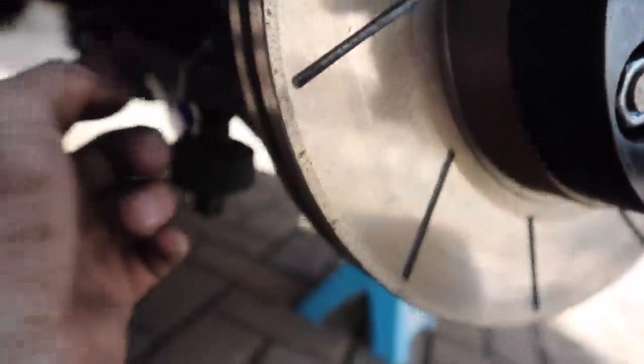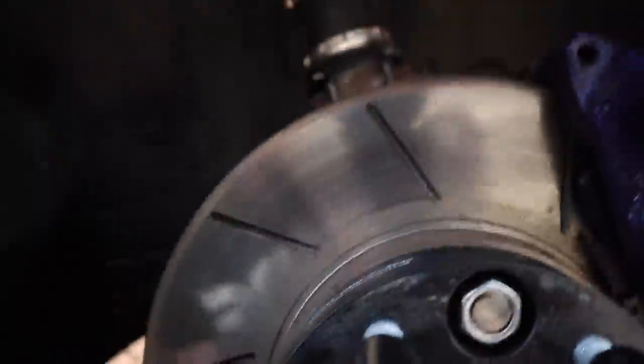Can you see the difference between this one and this one? Yeah, piece of shit, right? And that is one side done - absolutely solid. We may need to adjust the tracking a little bit, and when I got it tracked the other day that's a waste of time. I think I need to centre my rack as well, so we're going to centre the rack on Friday too. There's a little bit of elongation on the top hole of the coilover and strut, so I'm going to put them both on full camber, full slam back. I'll do the other side - it'll take five minutes.